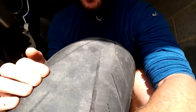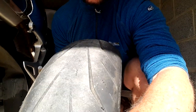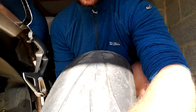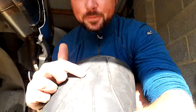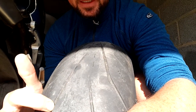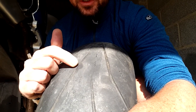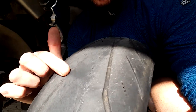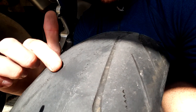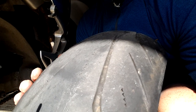You can probably tell — there's a wear limiter. Just here — there's the groove and then there's a little notch just here, that's a wear limiter. It's just approaching the wear limiter on here. Then there's another one further around, and this one is completely level — that's why it failed, it's literally below the limit. You don't need any fancy measuring equipment; you can just look for these little ridges and that shows you that your tyre needs replacing.